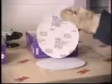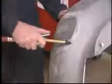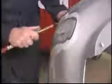Dish out the damaged area. Switch to grade 80 DA disc and continue to dish out the repair, ensuring that there are no sharp edges that will cause the repair to be visible once completed. Finish the dishing out and blending into the undamaged area with grade 180. Blow off the repair area using clean, unoiled compressed air.